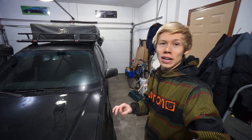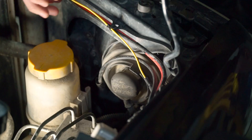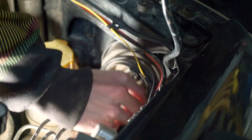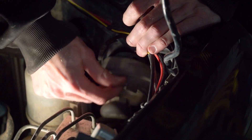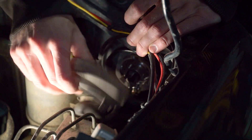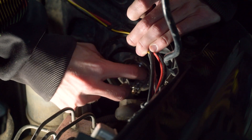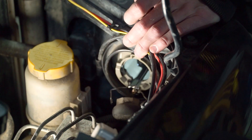With that done, the upgrade is just as easy as switching your bulbs. To change the bulb, all you've got to do is pop the hood, then squeeze the connector on both sides — that removes your connector. Then remove this rubber grommet by simply pulling it from this little tab here. Take your rubber grommet and set it to the side, then push these two middle brackets out and remove your bulb.